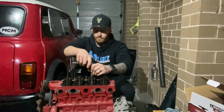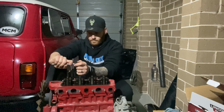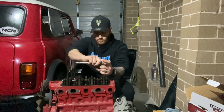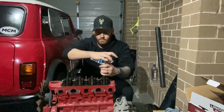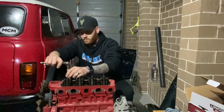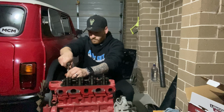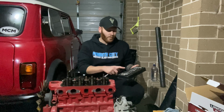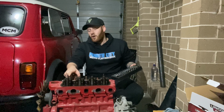Now, when you loosen and tighten things, there's always a particular sequence. Make sure you consult your owner's manual or workshop manual as to how to do it in which order. Now there's always the right tool for the job, like I was saying before. We're going to use a set of deep sockets to be able to remove these nuts on the threads that we can't get access to using a shallow socket.